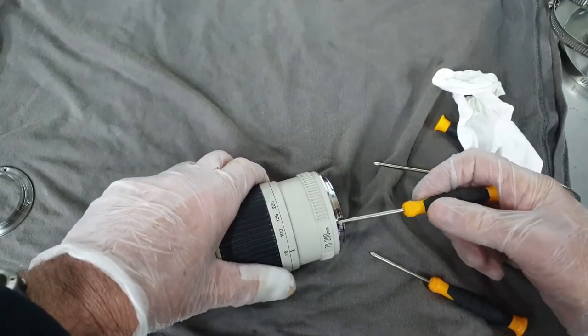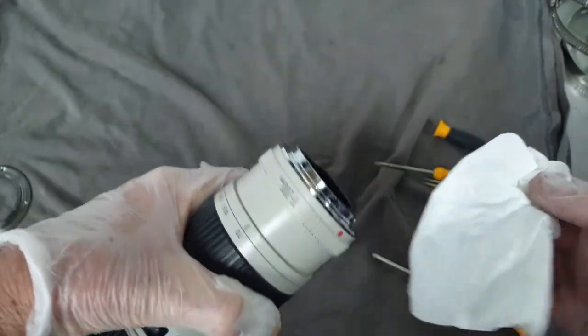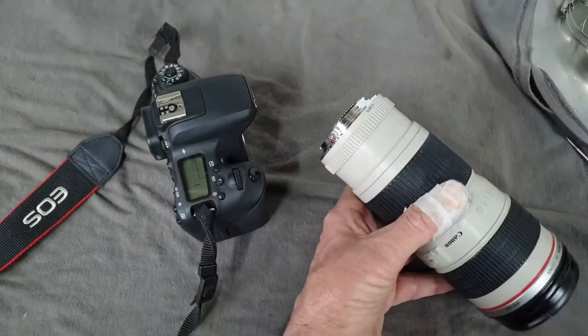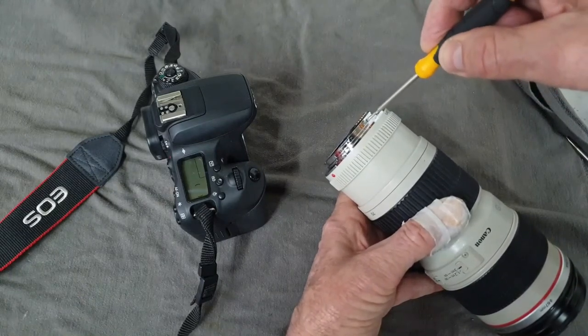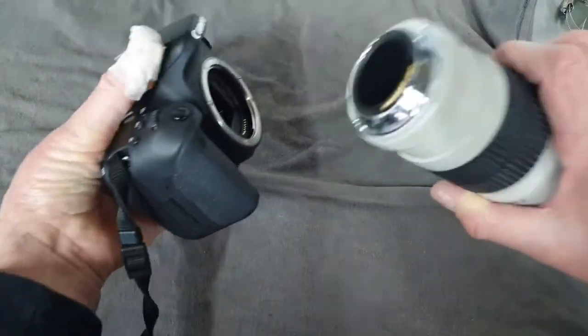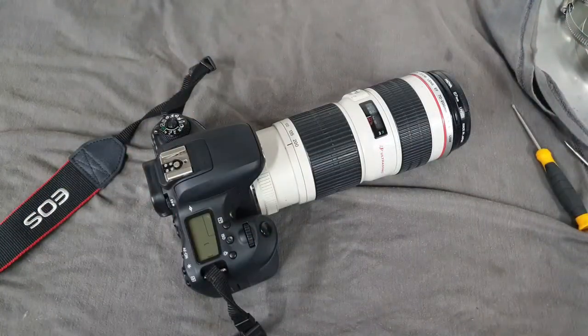They're all nice and tight. Just give the hot shoe a quick wipe — we should be good to go. Let me stick it in the camera and see how it performs. One final job to do before I remount the lens: just to check the tightness of the two screws holding the hot shoe in place, as I only nipped them up during assembly. I'm being careful not to over-tighten them — I'm sure they'll strip very easily. Anyway, let's remount the lens. Perfect. To finish off the video, I'll take a couple of pictures, one at each extremity of the zoom, and we'll see how the results compare — just to check the autofocus is still working. Thanks for watching.